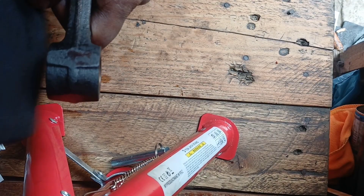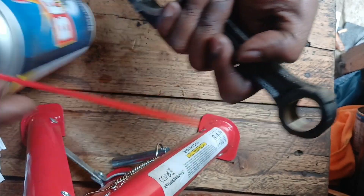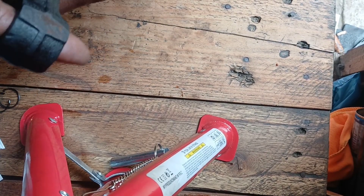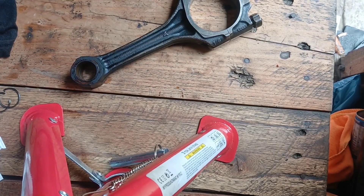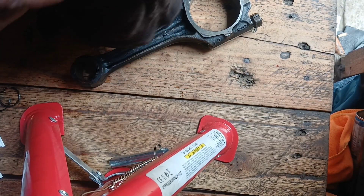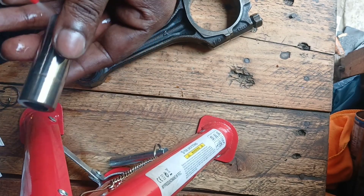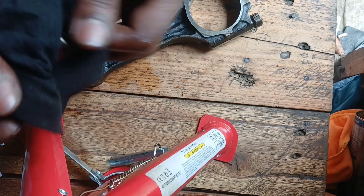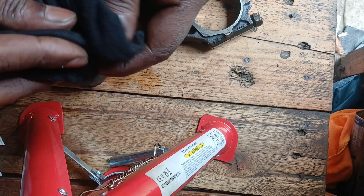I have my con rod. Inside the con rod there's an oil port — I gave that a good spray with some brake cleaner and a good wipe to make sure it's clean. You don't want any dirt in there. Take my wrist pin, give the wrist pin a good clean as well. It has to be super clean because you don't want your wrist pins to get damaged.